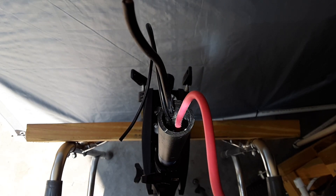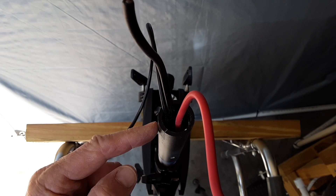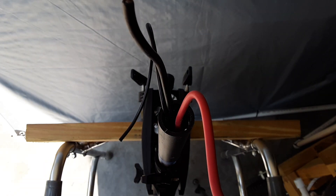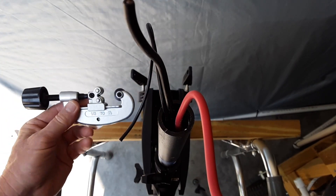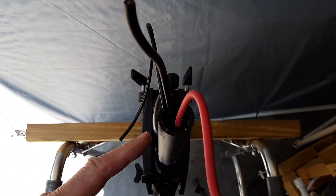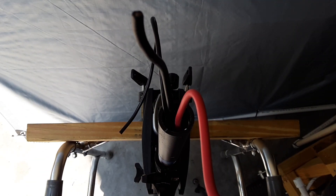I've removed the head and cut the wires so I can get in here. Inside the shaft is a little area that's filled with silicone — I'm not sure how deep it goes, but it'll at least go down here to where I can see it for the hole that was drilled to hold the head unit on. So what I'm going to do is cut a little bit below that with this pipe cutter. That way I can pop out that piece of silicone because I don't want to tug on the wires. So once I cut that piece off and get the silicone out, then I can go a little bit deeper and cut my length at 30 inches.